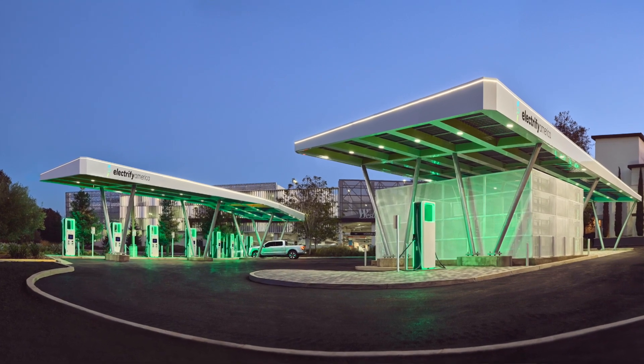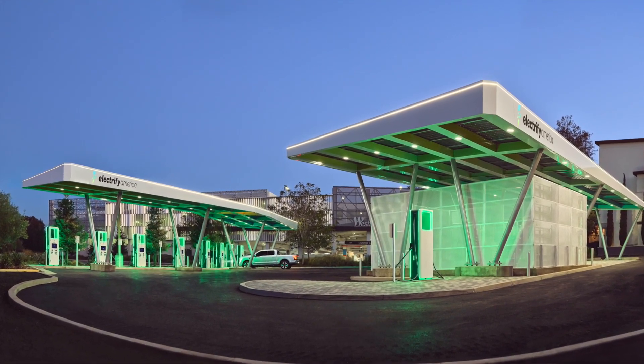I am sitting at a 350 stall at Electrify America, and hopefully no one's going to kick me out — there are plenty of other stalls available even though it's pretty busy at the mall today. I've driven the car from 34% state of charge, ripped it up and down some highways, and let it regen a lot, so the battery's pretty toasty. My battery temperature is 78 degrees right now, which in my experience is what the Mach-E's battery likes to be at if you precondition and set a departure time before leaving.